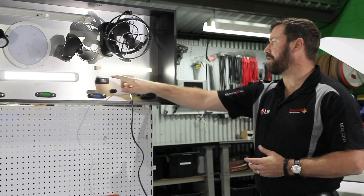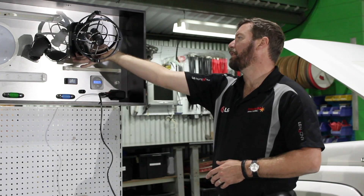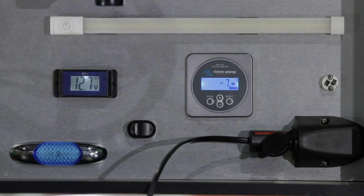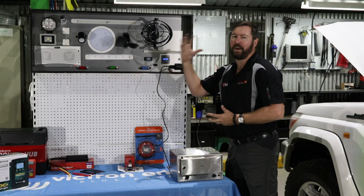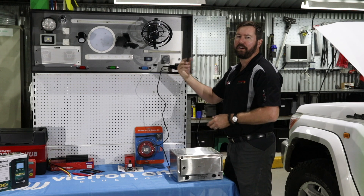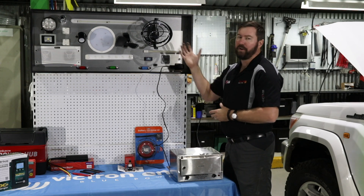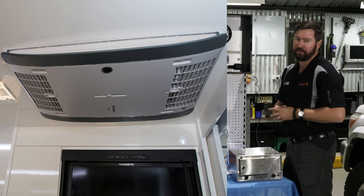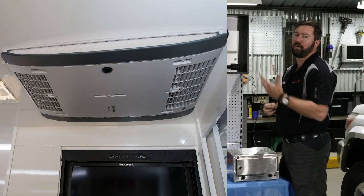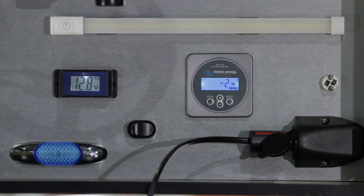Turning the lights and fans off, we drop back to just our standby load of two watts. This small Sirocco fan on low, medium, and high is drawing five or six watts — the energy draw from this sophisticated little fan is quite low. You can run that for 10 hours overnight, set the timer, run it for long continuous periods and it will drain a very small amount of power from your battery. By contrast, trying to run an air conditioner through an inverter off your battery, you'll go flat pretty quickly — an air conditioner might draw 1,200 watts versus five or six for the fan.